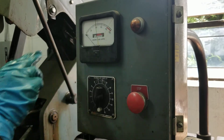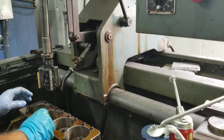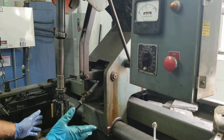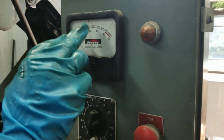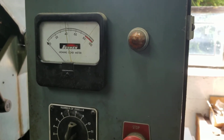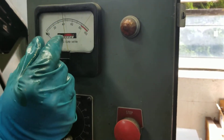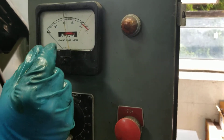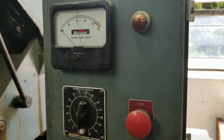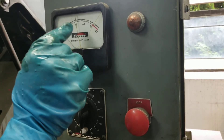What you're trying to achieve is as the cylinder bore gets nice and straight and concentric — when we're looking at figures down into the tenths, or plus or minus a tenth or two — we're going to see this needle basically staying in a short period of sweep. That's what we're looking to achieve: the cylinder nice and round, holding a ring package very well, with the load nice and consistent. That means the stones are seeing an equal amount of friction up and down the cylinder bore — one indication that your cylinder is nice and true and round.